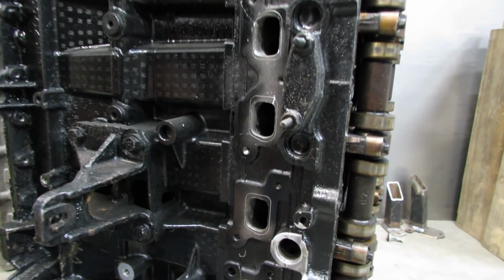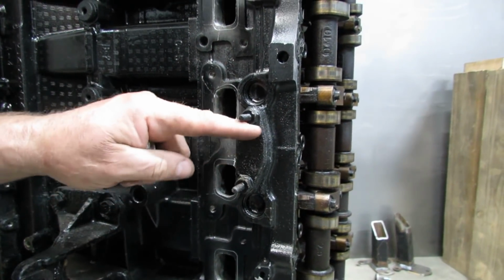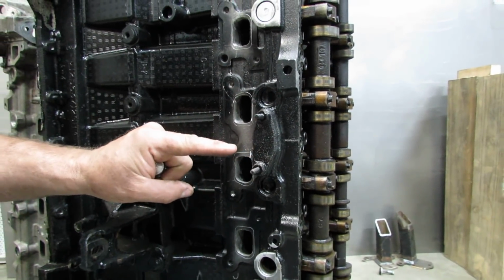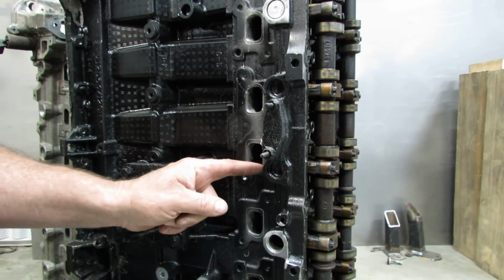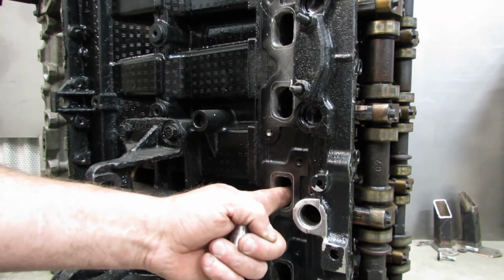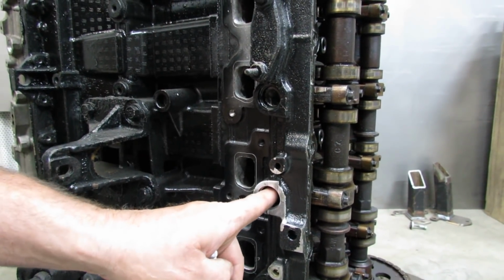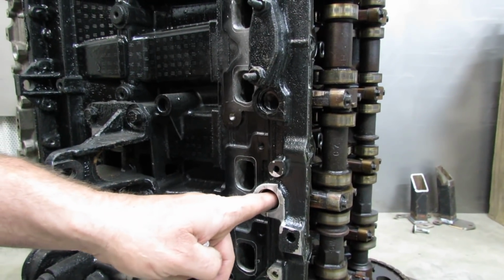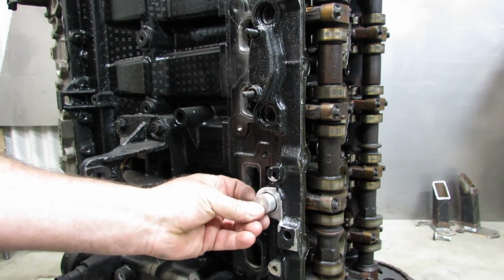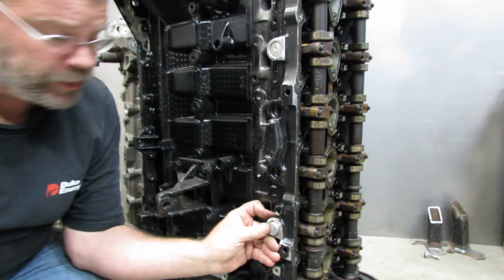In addition to that, there's an air injection port that comes to this. This is where a solenoid sits, not on all cars. On this one, it had a factory block off plate. But we know that this passage goes through and into the exhaust system, and right here my finger's on the end of this port. And since these three are connected and they all come to a reduced section of the porting in here, we made this plug to stick in this hole so that we can drive it in and block off all three ports.